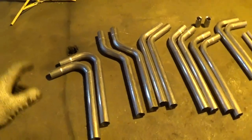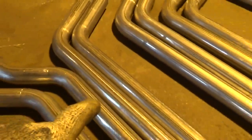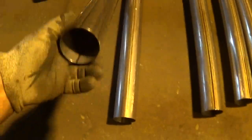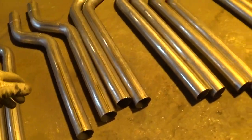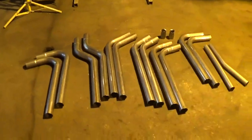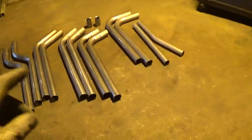It's all set up for clamping - everything has a four-inch deep flare on the end of half the pipes, and some don't have it at all. That one I'd imagine is intended probably over the axle. Pretty heavy wall pipe - not super heavy but it's got some beef to it. I've got my gloves on because like I said it's soaked in cosmoline oil - you can see how thick it is on there. Before I get started I'm going to get a can of brake cleaner and wash all these things down since I am going to be welding my exhaust. I'll get that oil off and start making some cuts to see if we can make this kit work.